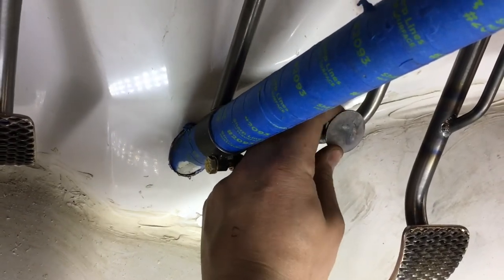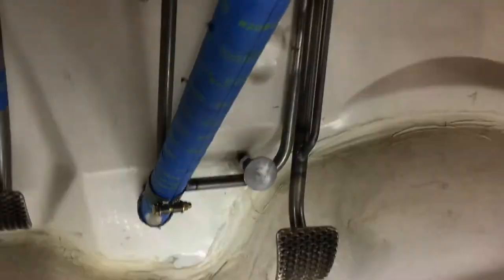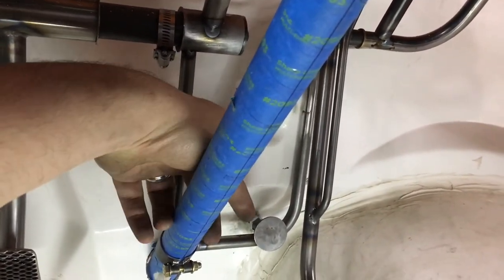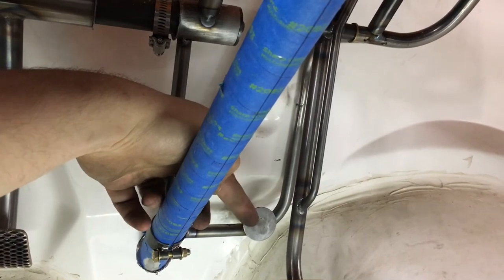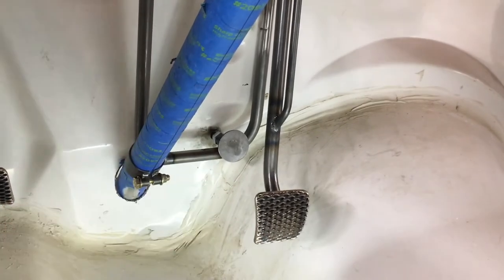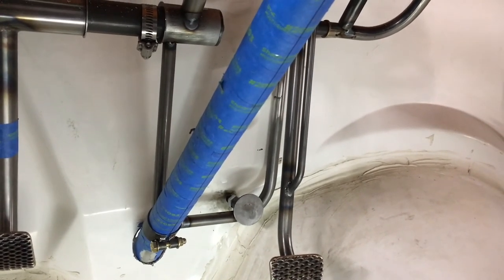You can see we've got two nuts so we can adjust the throttle stop in and out. It's just a little piece of tubing that an all-thread sticks through, and that all-thread is welded on. Once you finally get it where you want it, you tighten it all up. Now you've got a throttle stop - so when you hit the throttle you've got somewhere for it to butt up against instead of the firewall. This also lets you set wide open throttle precisely so you don't break throttle linkages or damage the throttle body.